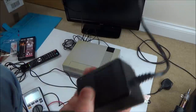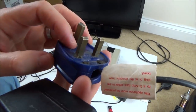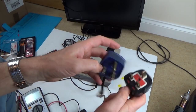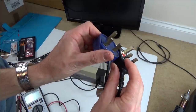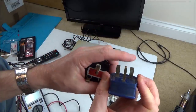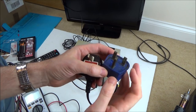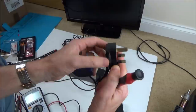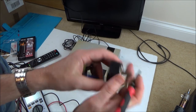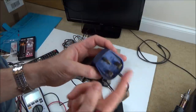Right, okay. Oh, actually, sorry. My working power supply's got a really short lead as well. You can tell how old this one is because, look, it hasn't even got the sleeves around the live and the neutrals. So basically, this plug now wouldn't be allowed to make an item with this on anymore, because have a look at the newer style plug. Can you see it's got a sleeve round here? So in theory, if you were a young child, you could put this in, and I think it could get live, if you had very small fingers, and you could touch your fingers on it, or maybe not so much your fingers, but let's say a screwdriver or something. When you plug this in, as you start to unplug it, it would disconnect by the time you have a chance to reach onto the copper, or the brass, or whatever this is. But with this one here, you could unplug it and it could still be connected and touch it here, so you're not allowed these anymore.